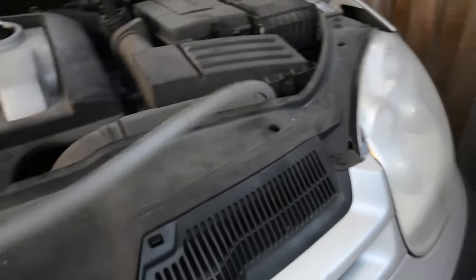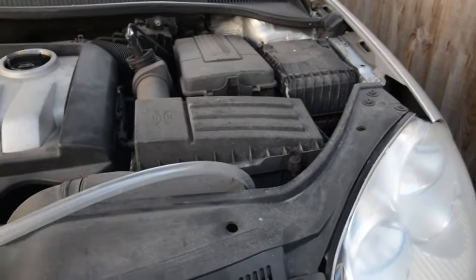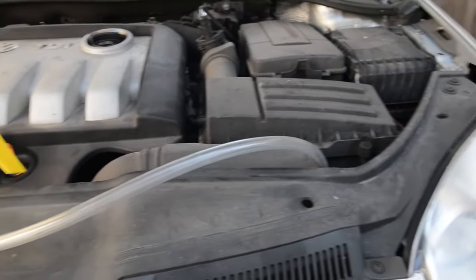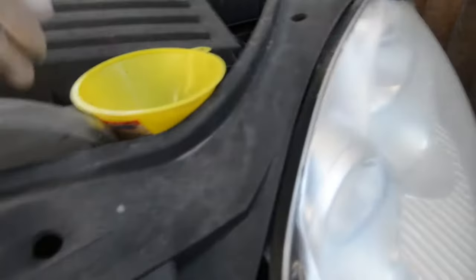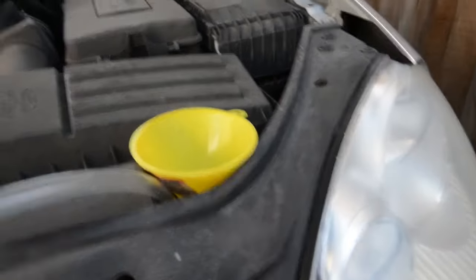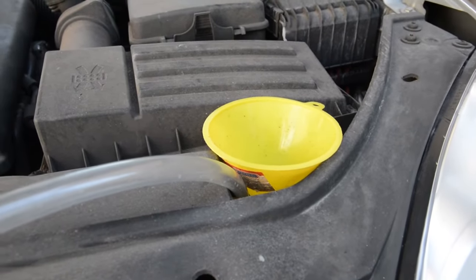Right, now we come to refilling the gearbox. I'm going to do this with a clear plastic tube, which will enable us to have a bit of a gravity feed, rather like a hospital drip if you like. This is really a two-person job, but I could always just shorten the plastic lead, and that little funnel would just sit there quite happily, and just top it up from the top, and when the thing's overflowing down below, you know you're full.